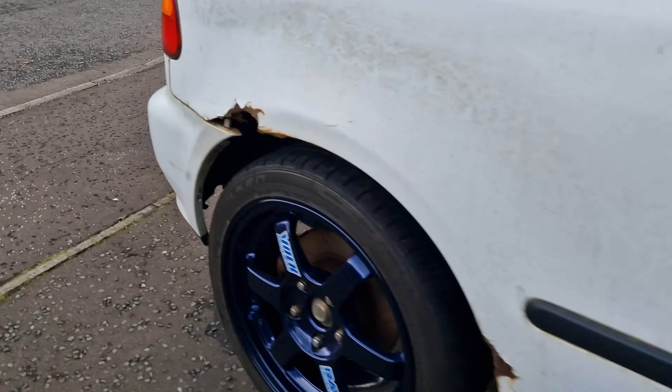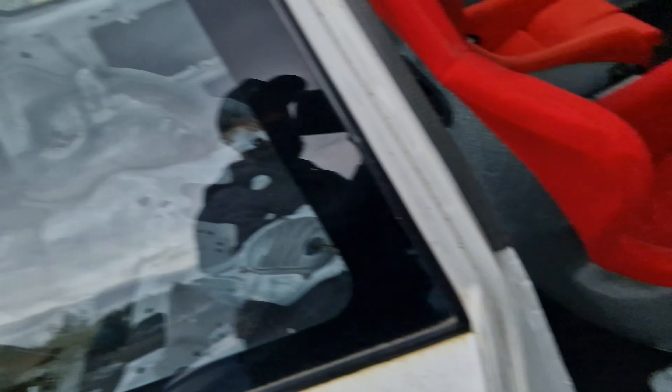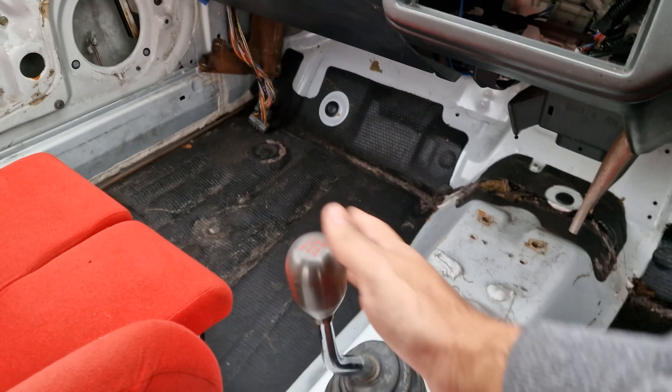There are two hangers underneath the bumper and one just behind the controller, and that one's sitting a wee bit offset. I reckon if I take about an inch off the mid pipe that'll have that line pretty much bang on, and it'll also have the exhaust sitting just that little bit further in - right now it's sticking out a wee bit too much. I'll get that done at a later date, but it fits, which is the main thing. Also got the gear linkage sorted - I have never experienced a Honda with a tighter gear linkage than this, it's incredible.